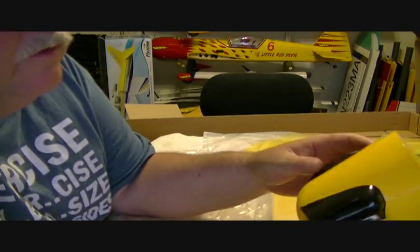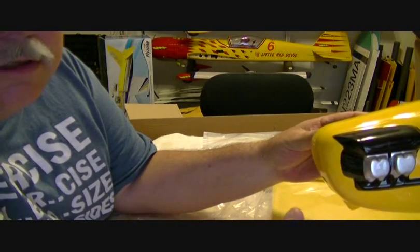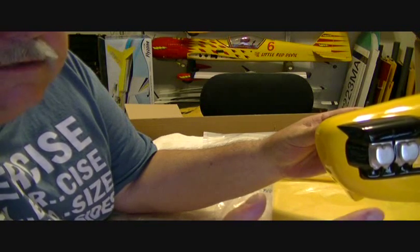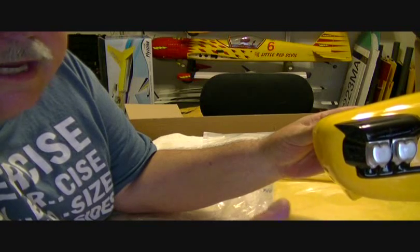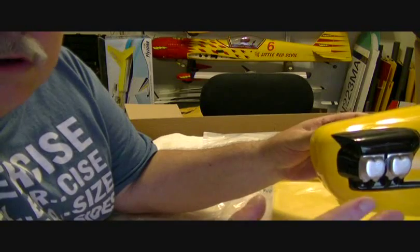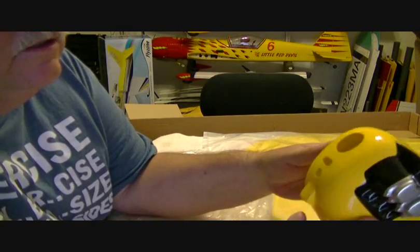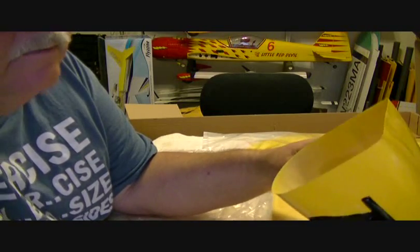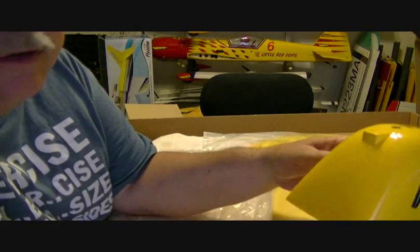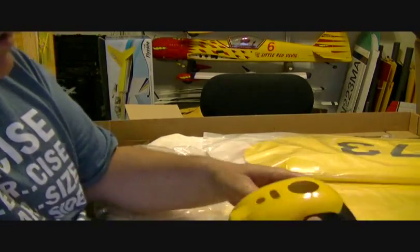I watched some people testing them on YouTube, and the GT15, which is the electronic ignition model with a spark plug, and then the GGT15 glow gas model. The GGT15 glow gas model is stronger and has more RPM than the regular gas one, even though they're both the same size engine. The glow one has more power and more RPM, running the same props and everything. And they run extremely well. You just have to put a glow starter on them to fire them. So no problem there. But anyway, I don't know for sure.